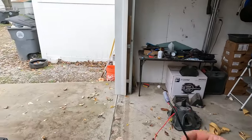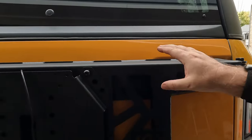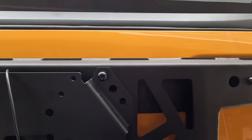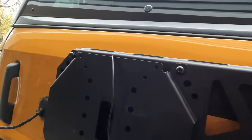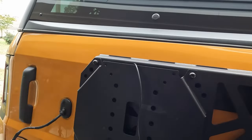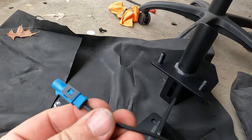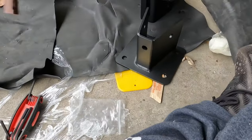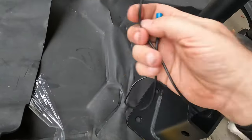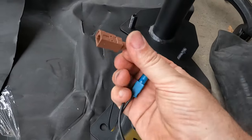This wire here is the camera for the Wolf Box. Now if you didn't have this reinforcement bracket, you'd just use the factory holes that are there on the Bronco — there should be eight of them — go through, put all eight in and tighten them down. Here is our camera extension cable. This cable looks exactly like the one on the forward-facing camera.